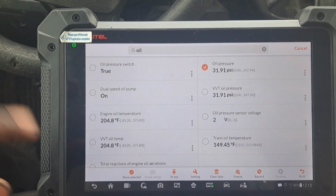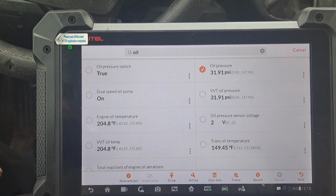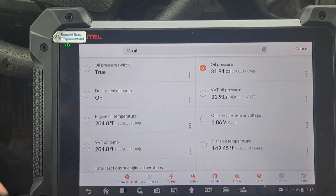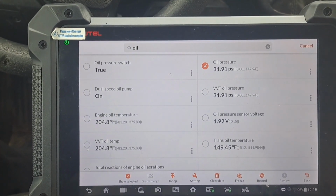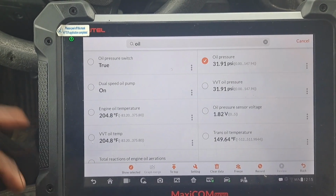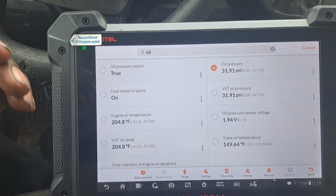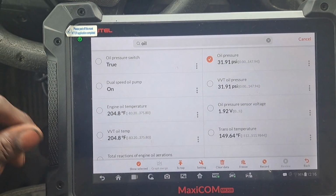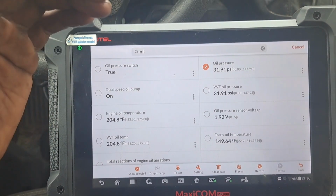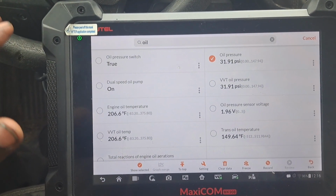There were two 10mm bolts and, I want to say, a T45 to get the gear for the oil pump drive. It was easy. I used an Allen key, a longer L-shape, to lock in the tensioner when I installed it. So just be mindful of that, like a grenade pin, when you put the tensioner back. It went smooth. But if anything happens, I'll definitely update.